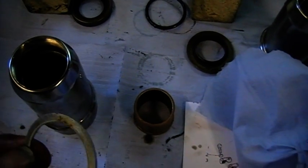Now this is really, really important, because this tiny little area here is all that O-ring seals on. That edge there, make sure you take a bit of wet and dry and really make sure that edge is rounded. If you can feel any sharpness on this edge, it'll cut that O-ring to pieces. So, spacer in first. That goes in like so. Then you put your O-ring. Spacer first, O-ring second. So you put that in that little groove.